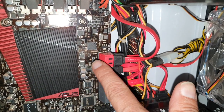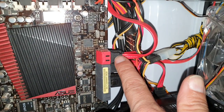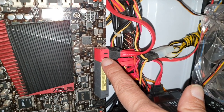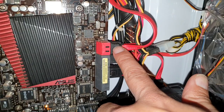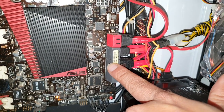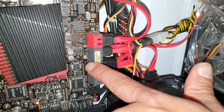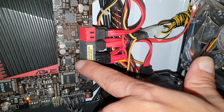And at some point I thought, this is not possible, because RAID 0 normally gives you double. That means when a single SSD here brings about 380 megabytes per second, on a RAID 0 you should get about 600 megabytes per second, okay? So one day, long time ago, I wanted to know that, and I switched the 2 SSDs to these ones. I restarted my system, and then Intel Rapid Storage displayed if I want to do a RAID 0 system over the Intel Rapid Storage. And I did it. I just tried it out, and then voila, I had over 560 megabytes per second.